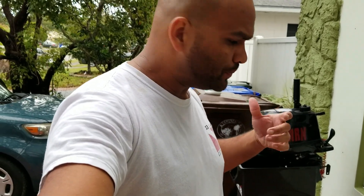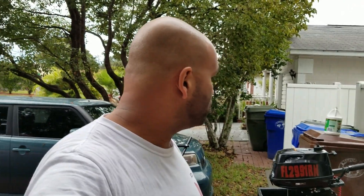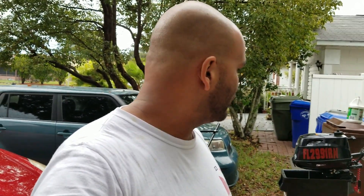I'm going to run it for about 10 minutes or so. I'm going to turn it on. The first five minutes I'll just run it normally, then I'll shut off the gas line so I can run it dry — it'll spend the remaining time burning off whatever gasoline is inside the carburetor, so whenever I take it out it'll be dry. The engine is running. I do not recommend more than 10 minutes because with the Slim Jim setup the water gets really hot — within 10 minutes it'll be almost boiling and you don't want the outboard to overheat. Although there's water flowing, you still want to take some precaution.